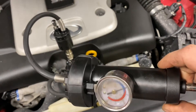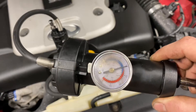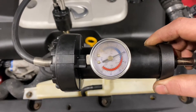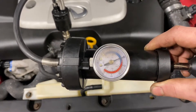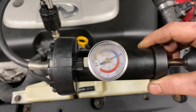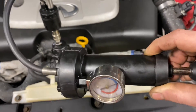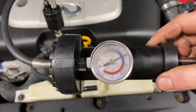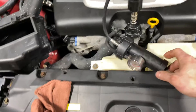Depending on the size of the coolant leak is going to determine how long you're going to have to wait to see the pressure drop off. As you can see, we've almost lost an entire PSI — we're approaching 15 now. You can see the needle slowly moving. This would be a very slow coolant leak. Sometimes you'll pump these up and you can't even build pressure in the system — if that's the case, odds are you're going to see the leak immediately because that's a very large leak. Cases where it holds pressure but slowly fades over time, those are the challenging, slower cooling system leaks. At that point, it's time to get your eyes out and start investigating the system.